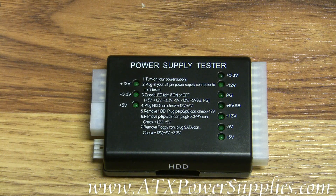What's so neat is you can test a new power supply along with an old power supply and get a good test on both. So many of the new testers that are coming out only test power supplies that are compliant to the ATX 2.03 standard. So what are you going to do whenever you get a client come in who wants you to test a power supply that may be 3 or 4 years old — one that has a minus 5 volt circuit on it? It's hard to get a good test when you don't have the proper equipment to test with.